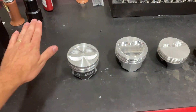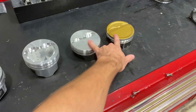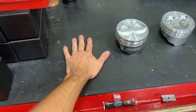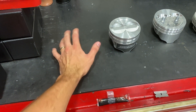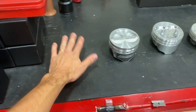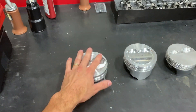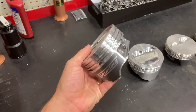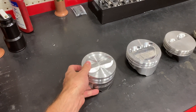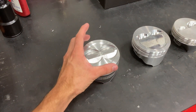There are basically four types of pistons available on the market. There's another one that is a cast aluminum construction. In my opinion, technology has come so far that no one should be running just pure cast aluminum pistons anymore. At a minimum, you should be running a cast hypereutectic piston — that's what this is.